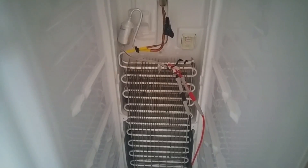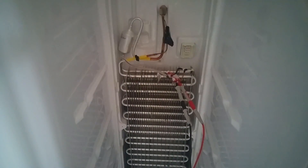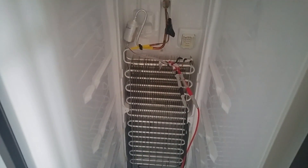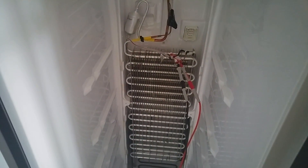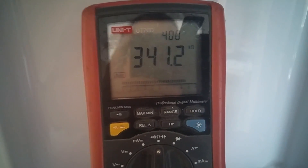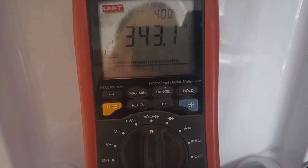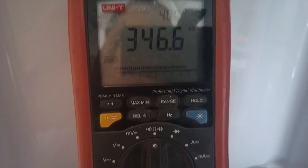The pair of brown wires going to the middle connector - I'm guessing that must be the heater. We're getting 166 ohms, which sounds like a much more sensible measurement for a heater. I'm just going to test the defrost sensor now. These leads on the defrost sensor are reading 330... going up... 340 kilo ohms and rising. That sounds very high for a temperature sensor - I would have thought it would be around 5 to 7 kilo ohms. Still going up. Yeah, I think that's dead.